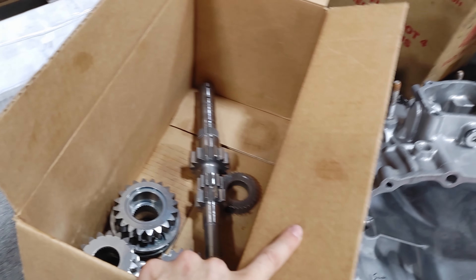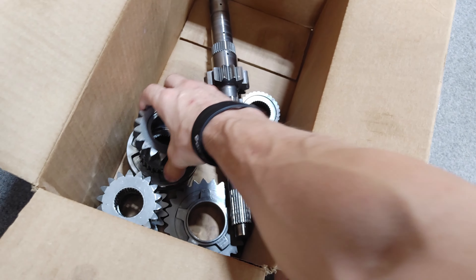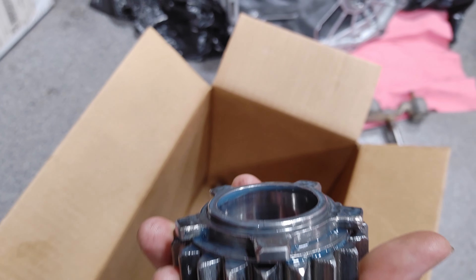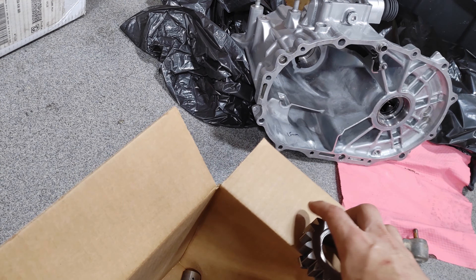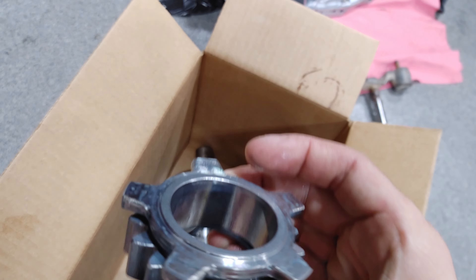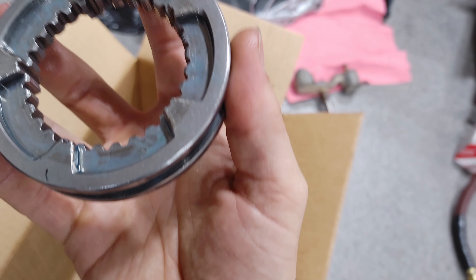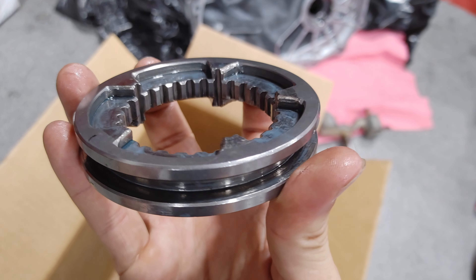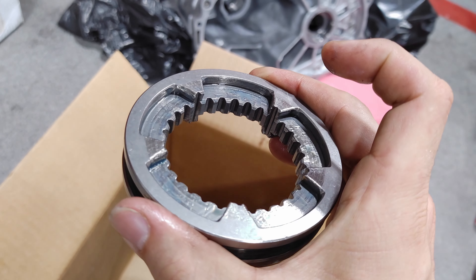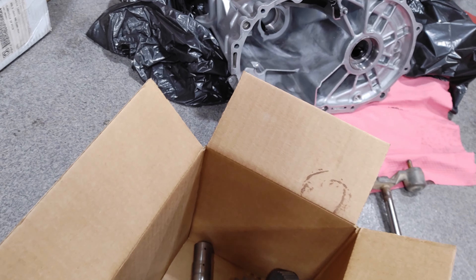The wait wasn't necessarily me — we were waiting on parts to come in. So last time the car was together it was kicking out of third gear. This is fourth gear, this is third gear. The dogs were pretty messed up on it, but what was really bad was this 3-4 slider — yeah, pretty nasty right in here. So it wasn't staying engaged in third gear and would pop out just driving on the street.